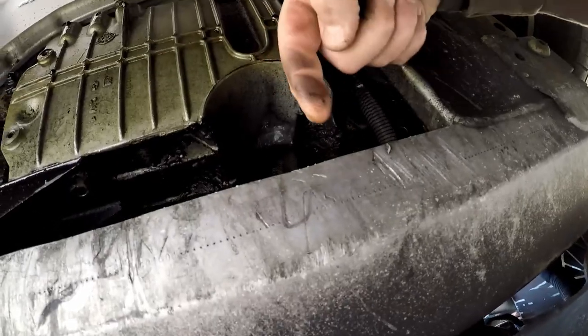When you're taking your drain plug out, loosen it with a ratchet, then as you're turning it by hand, make sure you hold it up against the drain hole until you hit that last thread, then pull it away real quick so you don't get oil all over your hand. I'm going to get oil on me now when I pull this filter out of here. The filter is located — I don't know if this is the front of the car going this way.